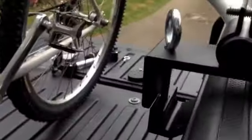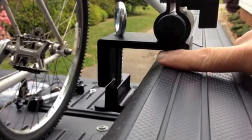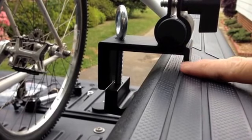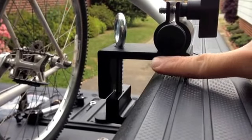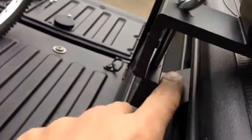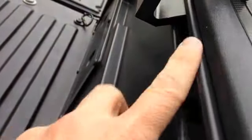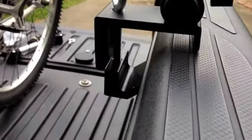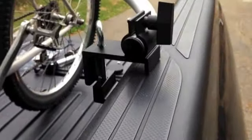How well does this work? You can see the clamp here with the eye bolt provided. The clamp rests on this little lip, so on the top at least there's not a very good amount of surface area touching the railing of the truck. On the underside, the bottom side of the clamp is actually pushing up on the rail that comes from the factory on the Tacoma. So definitely not a good clamped connection. I've got the bike hooked up here — let me move the bike a little bit and you can see the movement here.